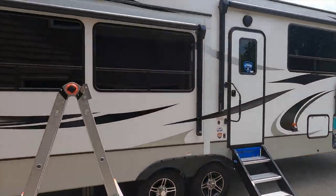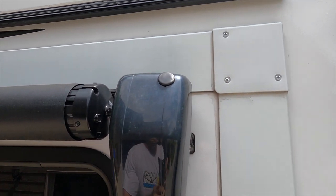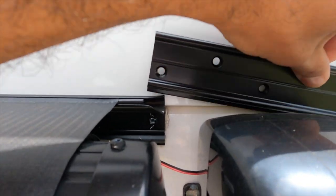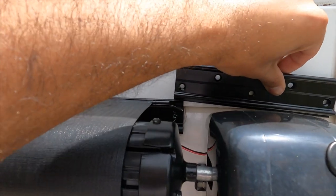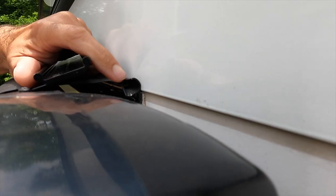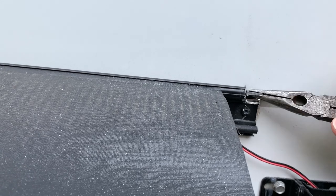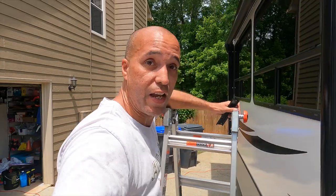The dinette slide — here's the situation. You have these plates that are supposed to go on top of the slide rails. Your plates can either install in this lower area or above on the wall. We can't put it up high because of the awning, so we have to install it here. But the awning track is too long for this bracket to fit. The other side is actually fine — I measured it and it'll fit there. So what I have to do is trim down this metal with my Dremel. I only need about three-quarters of an inch. I don't have my Dremel right now so I'll do that tomorrow. I've got two other awnings on the other side that we can do today.